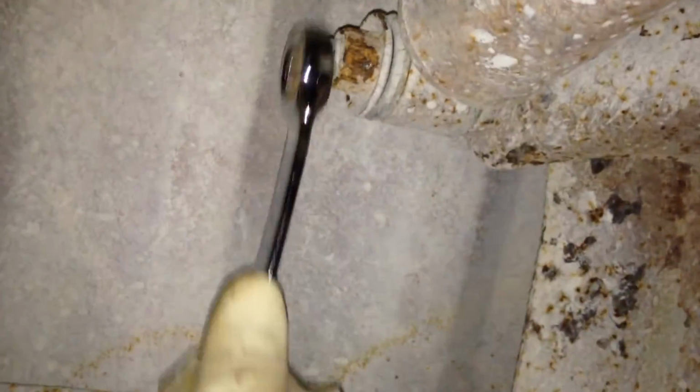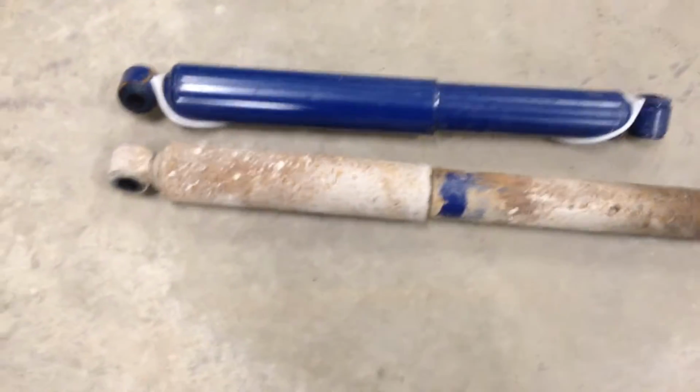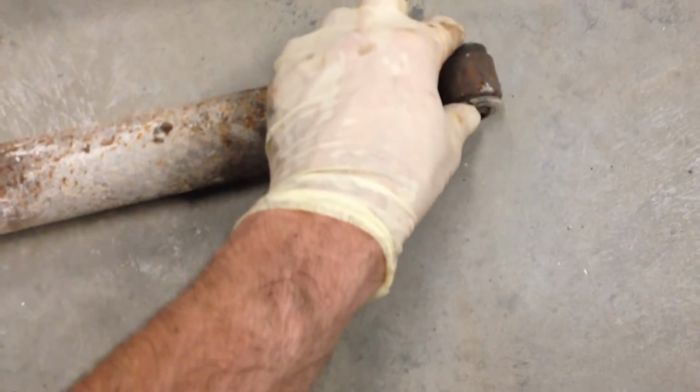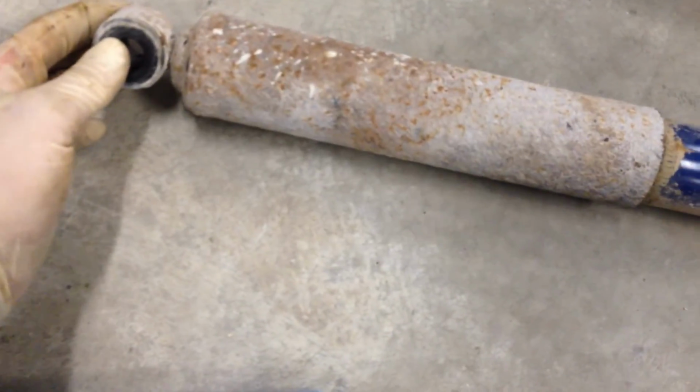Now on the top side, go ahead and grab your 11/16 inch wrench and possibly something to use as a cheater bar and break this free as well. Then back both of your sets of bolts completely out. Here are the two struts together, the old and the new. So the last step as you're taking this out, just back the bolt out of the bottom side first and this unit will extend, and then go ahead and pry the top end free.